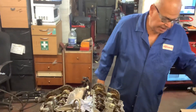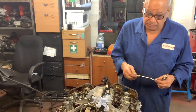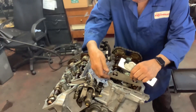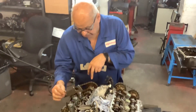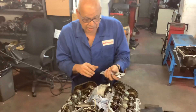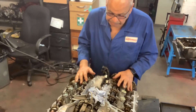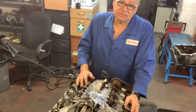You don't actually 100% need these cam locks, but they certainly made my life a little bit easier and give you a check to make sure you've got the cam timing right. You can see they are aligned — you could put a ruler and measure the distance here and the distance there should be the same. You could do the same on the other side. If you don't have these locks, you could mark your cams up to get them spot on. You don't actually have to take the cams out.